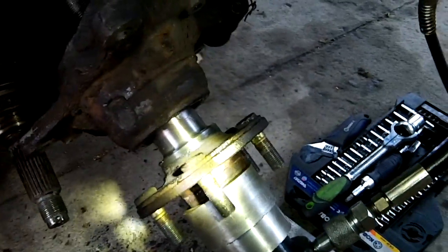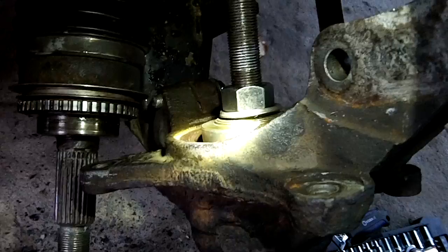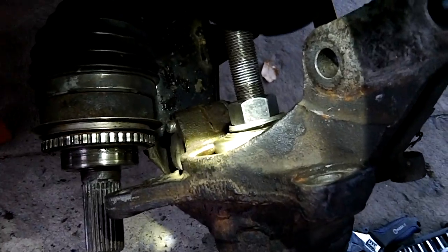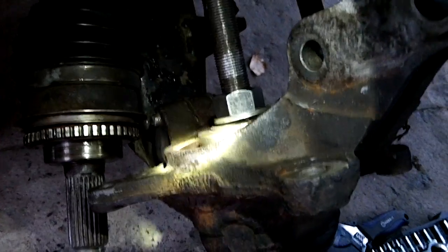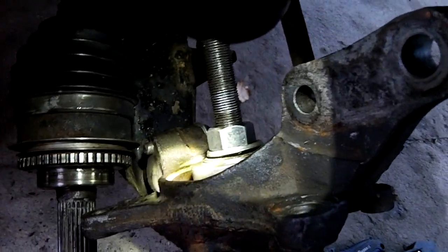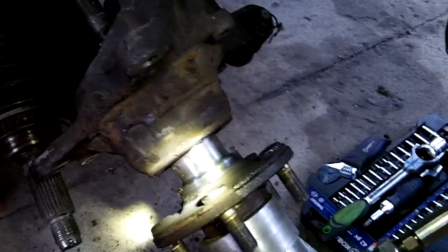Now I'm putting the hub back on. I pulled it off with, I guess it's a gear puller. But before you put the hub on, make sure you get that seal in there. And I really screwed up over here. I put the seal on the back side first. Not the worst thing in the world. You want to push on the inner race when you put this hub in. And now since I put the seal in there, what a nut, I had to actually use the old inner race to push against the other inner race to get everything to go together. Otherwise I'd be pushing on that crazy rubber seal. I don't want to take it out. So anyway, everything should go together pretty well. Slap it back together. Should only take a few minutes.